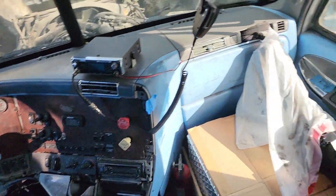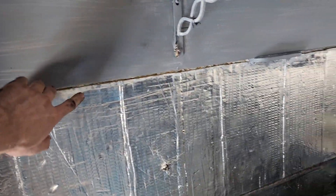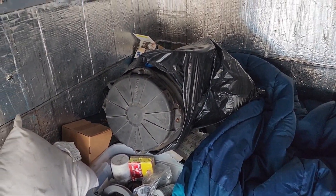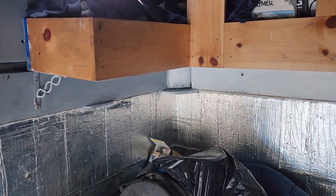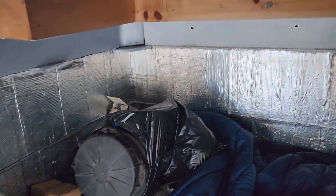I've ripped out all the other interior inside the rig because these old Freightshakers usually leak water up around the seams, so this was all redone. It's really thick insulation — over two inches thick all around — and I have insulation even under the bed. The bed doesn't fold up anymore and I have two inches of insulation on the sides and on top. This thing can keep much cooler in the summertime and in the winter it can trap heat, but if you don't run the heat overnight you can wake up and it's like an icebox — maybe 20 degrees in here with frozen water bottles while outside it's already 35 degrees.